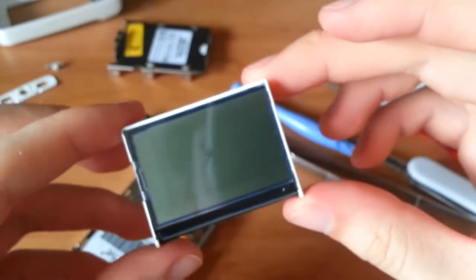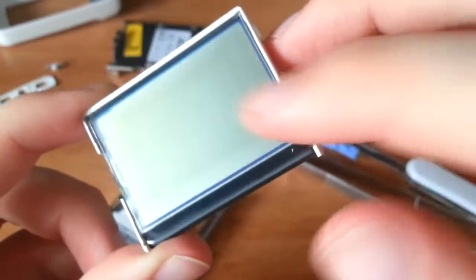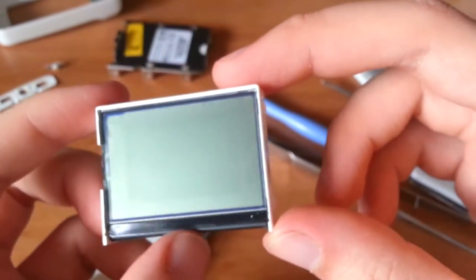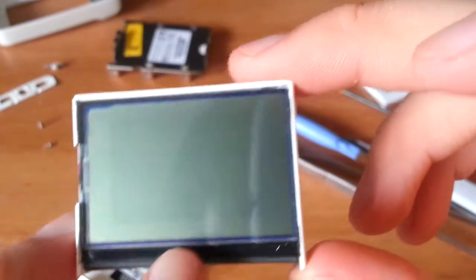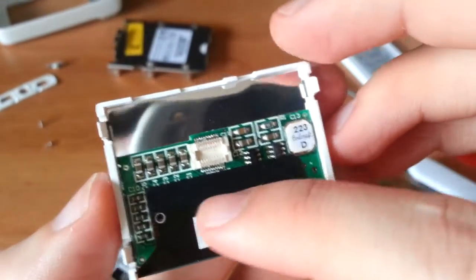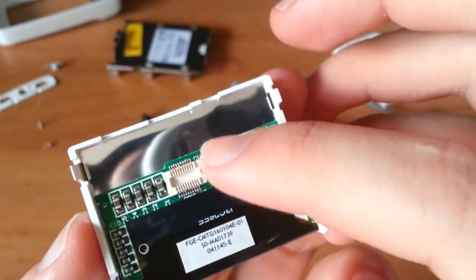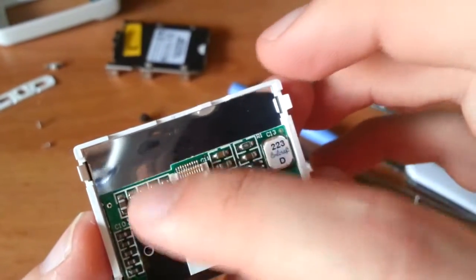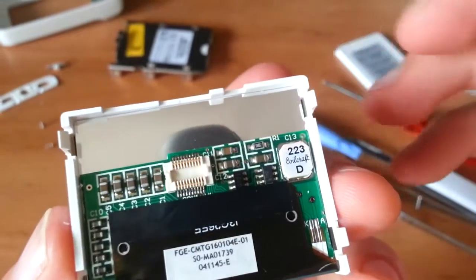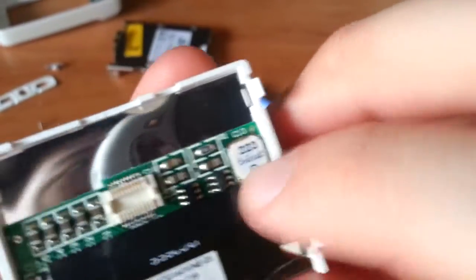It's just a monochrome screen, with a blue backlight, and the display area, you can kind of see the outline of it there. It's not the full screen per se. You'll notice the chip on glass, which is right at the bottom here, covered in silicone. And finally, the ribbon cable wraps around. It's heat bar soldered, most likely, and you'll notice the decoupling caps or the bootstrap caps for the internal supply that it needs to generate for the high voltage segments, the Molex connector, and some power supply circuitry, as well as a Coilcraft inductor in there